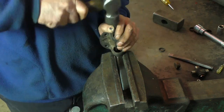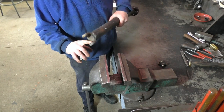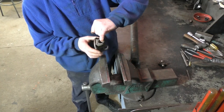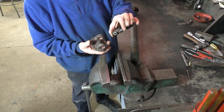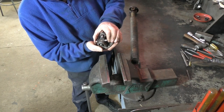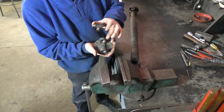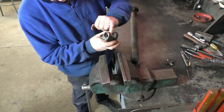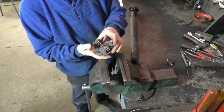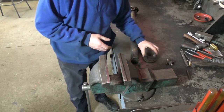I've cleaned the end of the shaft — all the oil and grit — and did the same with the flange, cleaning the inside with emery paper. One thing to mention: when you were hitting the cross of the U-joint through the flange, the shoulders of the cross touch the inside of the flange and can leave two dimples in the end of the hole. Make sure you take a round file and remove those dimples, because the caps need to push in further than that and it could cause a problem.